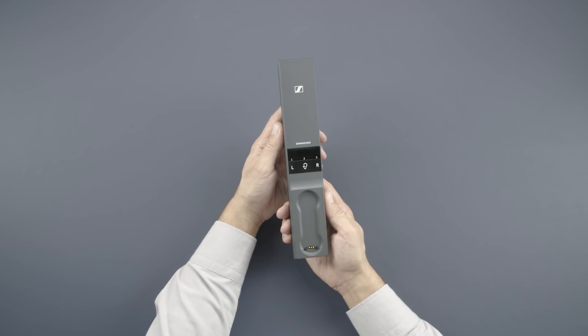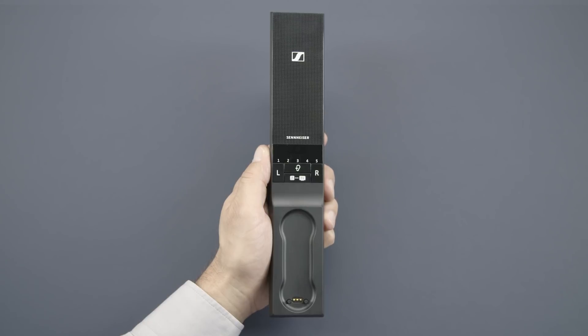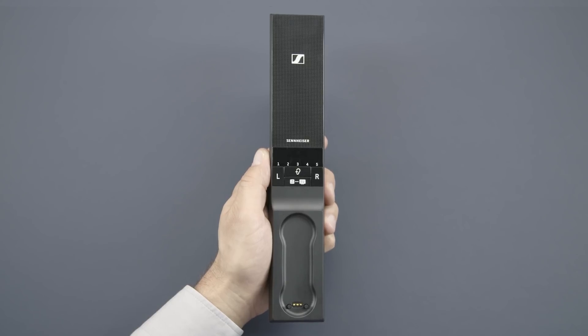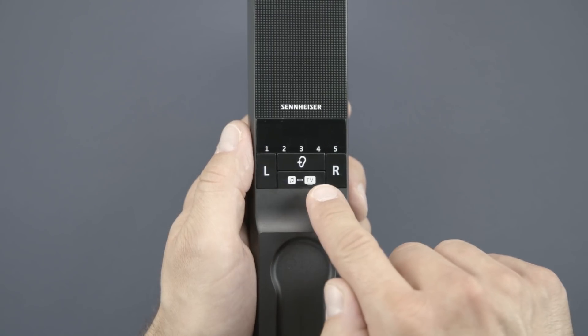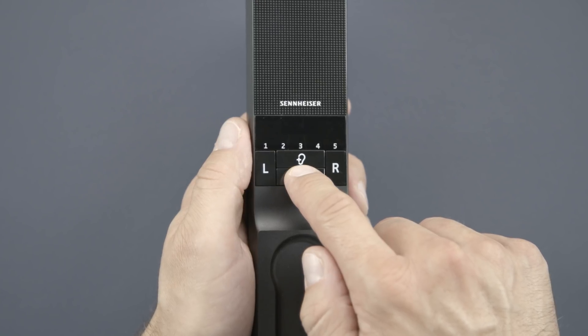That's the right one. Connect your set over RCA or SCART and your TV's loudspeakers will remain working. With the Z860, please connect either the digital or the analog cable. With the Z880, you can connect both at the same time — for example, the TV and the radio simultaneously. Press this button for two seconds to switch between the two.